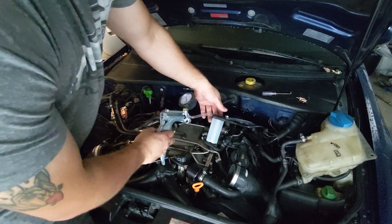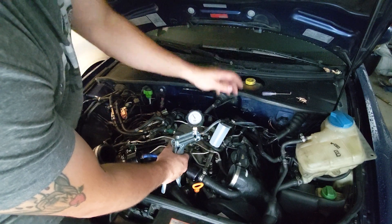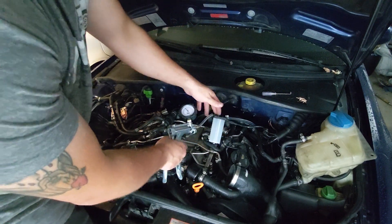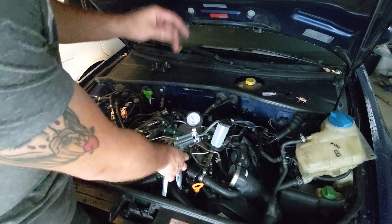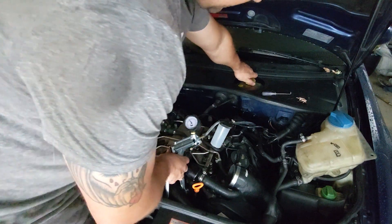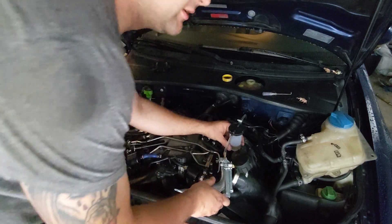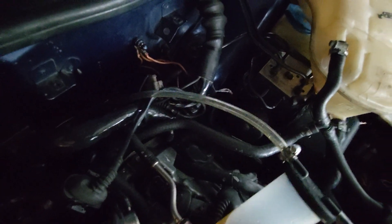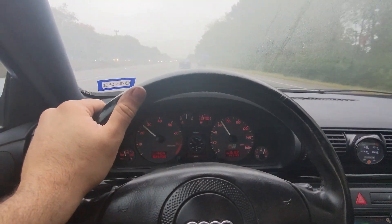I've got my Mighty Vac up here. What's going to happen is I'm going to go inside pressing the pedal a few times and then come out here and create a vacuum. That's going to draw the fluid up here and capture it while also pulling out any air in the system — the most efficient way possible to get all the air out. Look at all that air coming out! I'm going to keep bleeding this and make sure I've got a good fit down there.